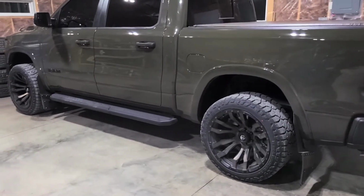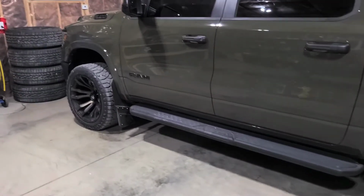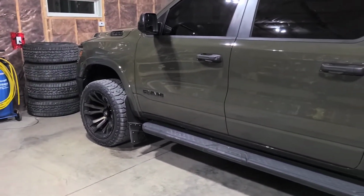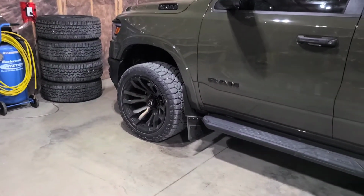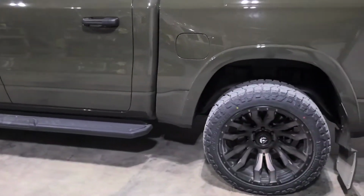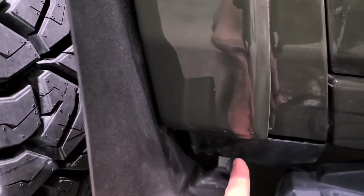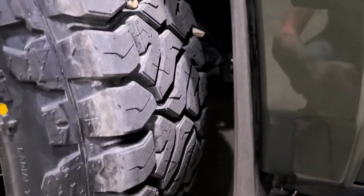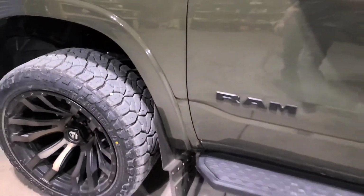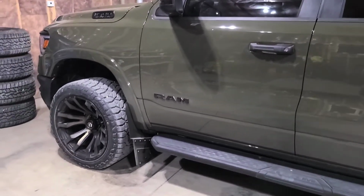because you can't turn. Basically, as soon as you start getting into the fender, into the side, it wants to catch. It rubs on the inner fender liner and the kickback, and it'll rip the kickback right off. But we got her. Basically there's this plastic piece down here that I had to cut, and then it gave me extra room on the right in here, and it gave me more room to make it fit. So it gave me like 3/16 of an inch.